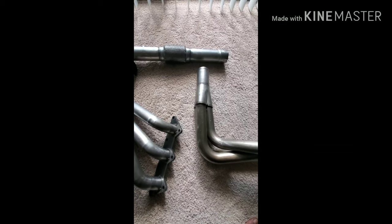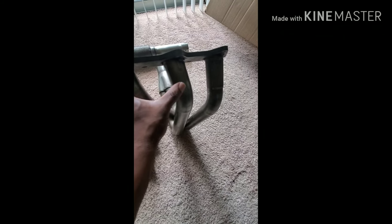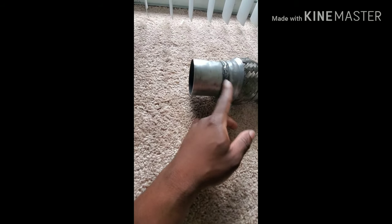I'm going to have to weld a few things. I'll have to weld an EGT port right here to measure my exhaust gas temperature — that's something I like to monitor while racing. I also need to either do a V-band or some kind of flange right here; it looks like it's a three inch, which is good. I need to put them on the car first because I'm not sure if there's a gap, since sometimes RIP headers bolt straight up to the catback and they are loud — super loud. So if there's no gap, I'm probably going to put a resonator to quiet it down.